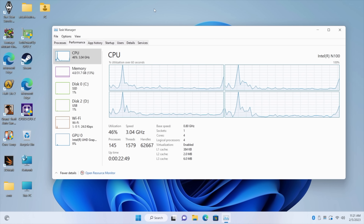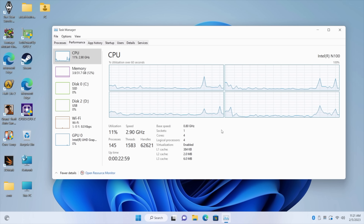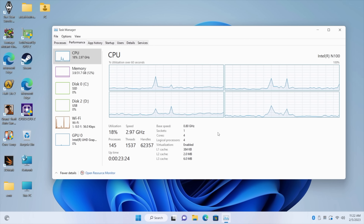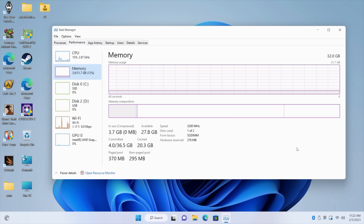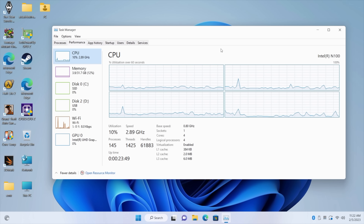I've actually been really excited about these new lower-end Intel chips, and obviously we've got the N100 here — four cores, no extra threads. We've got a base clock of 800 MHz and a boost up to 3.4. All in, this will pull around 14 watts with the GPU maxed out and CPU at the same time. The CPU itself is around 9 watts — adding any more wattage really isn't going to help because we can just kind of max this chip out on all four cores at 9 watts. This one has 32GB of RAM, single channel at 3200 MHz, a 1TB drive, and Intel UHD graphics with 24 execution units. The N200 has the higher-end GPU, but for what we have here and the price these are going to be coming out the door at, it's really not a bad little setup.